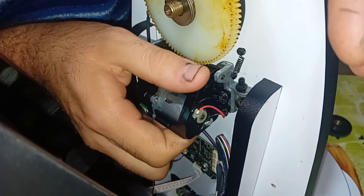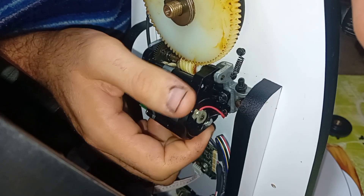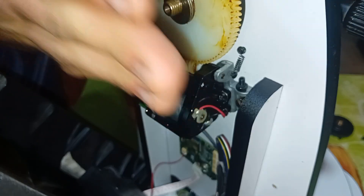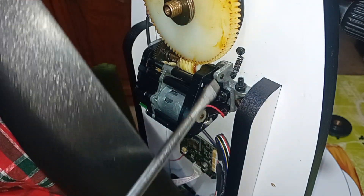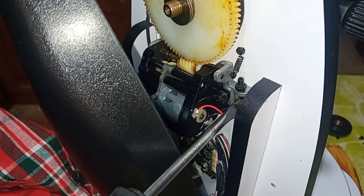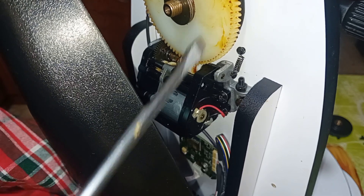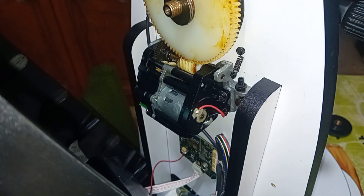Take the motor — as you can see there is play at the moment. Now let it rest like this because there's the spring applying the force. That's only tiny, tiny pressure — don't apply too much pressure here because if you apply too much pressure you can sneak the screwdriver in. You don't need to remove this cover. If you apply too much pressure you will break the gear or something like that. As you can see now it's not moving.